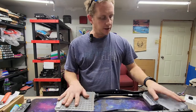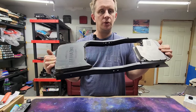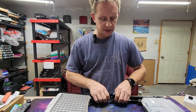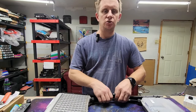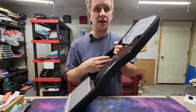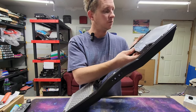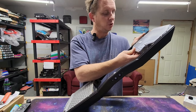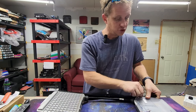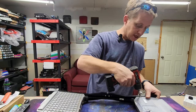I wanted to tell you, I had a customer ask me, do you have a problem with the wire harness on the Pint X? He said that his was too short and he was having problems getting the screws in. Well, I kind of had the same problem. If you're loosely trying to get them over there, it won't work. You have to pull it a little bit. I laid mine down, pushed it, held it, finger tightened my screw in, and then went back and did this side, did that side.